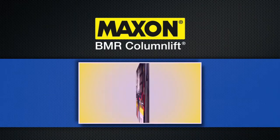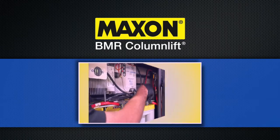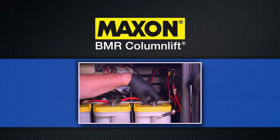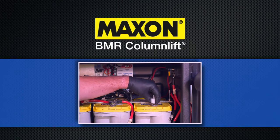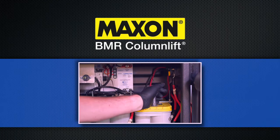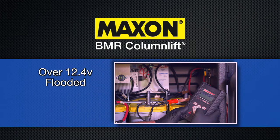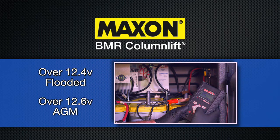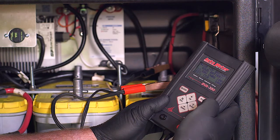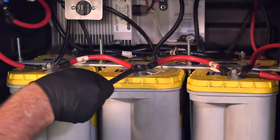Are the hold downs tight? Are the batteries damaged? Are the cables in good shape and connections tight? Check open circuit voltage and date codes. Remove the cables in order to separate the batteries. Let the batteries sit for a couple of minutes and clean the terminals. Add adapters and make sure the adapter is touching the lead pad. Check the voltage of each battery. A good pack should be very close in voltage and over 12.4 volts for flooded and 12.6 volts for AGM type batteries. Make sure to use the tester correctly. If the batteries are bad, replace them. If voltage is low, charge the batteries. Check all charging and ground cable connections.